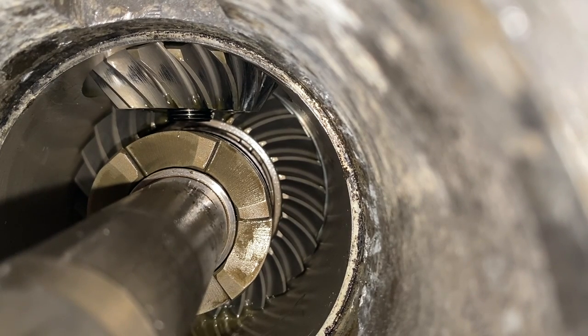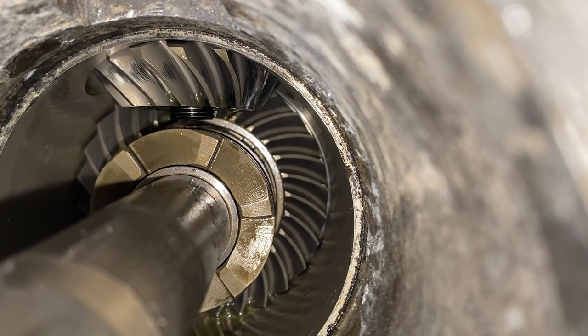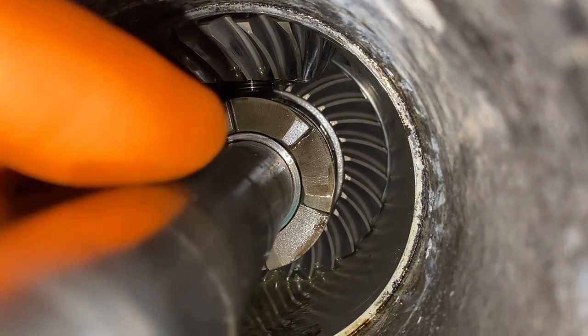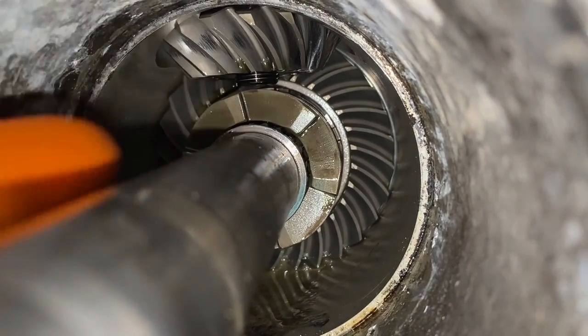You have to remove the upper drive shaft because that lower thread will not give you the clearance to shift that pinion gear down and out. You have to remove the drive shaft by pulling it all the way out through the splines of the pinion gear itself to get that clearance. At this point, it is a good time to shift the clutch dog forward toward the forward gear to give you better clearance to remove that upper pinion gear.